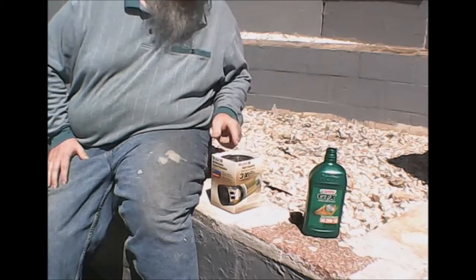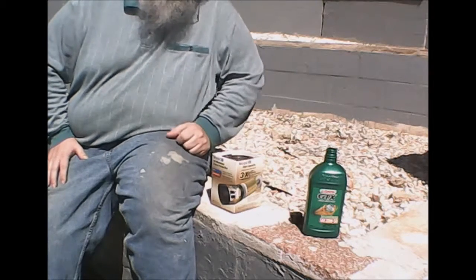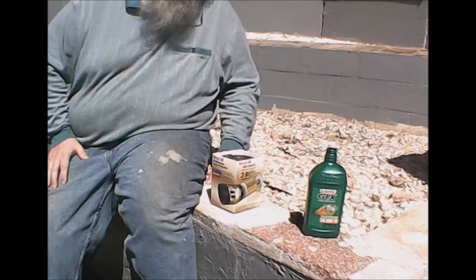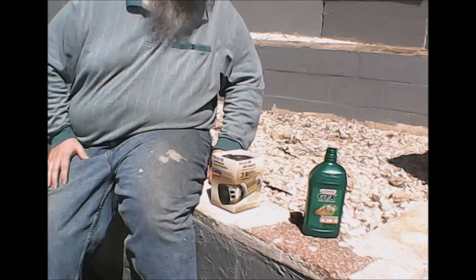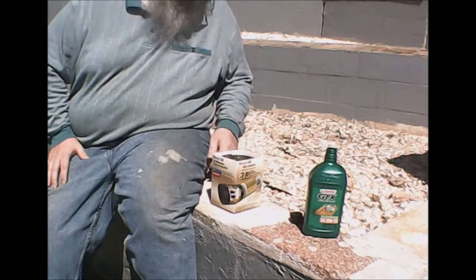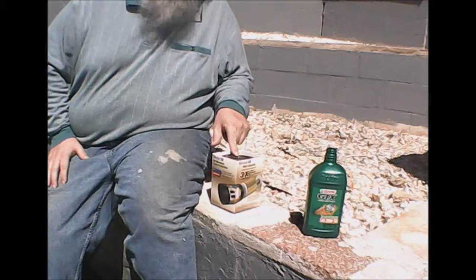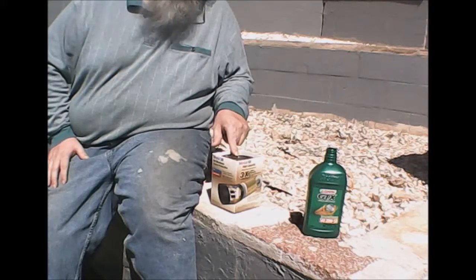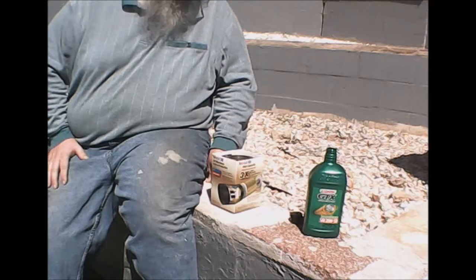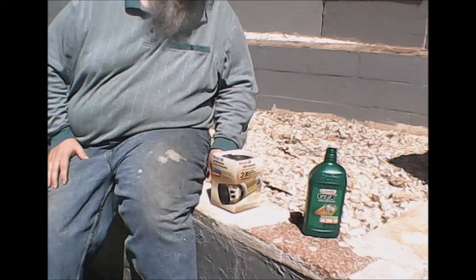What I'm doing is putting new oil in the new oil filter, and there's a reason for that. If I don't put oil in the oil filter and I turn on the engine after the oil change, then the engine is seeing a few seconds without oil running through it. But by putting the oil in the oil filter first, I'm able to shorten that amount of time. Of course, I could just put the empty oil filter in and start up the engine, but after doing that several times, the life of the engine can get rather short.